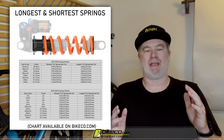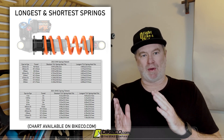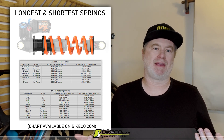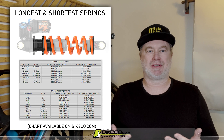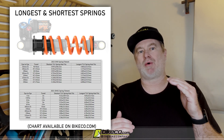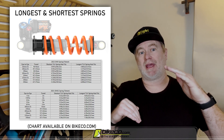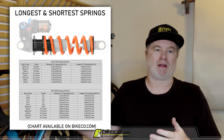When you're looking at coils, you've got some critical measurements you need to take into account. One is ID — it needs to be the proper inner diameter to clear the damper and not come off the spring perches. We work in a Fox-on-Fox world; there's really no issues there if that's what you're doing, but if you're starting to cross through brands, do take a look at that. You've got total length — each damper can hold a specific range based on that preload perch moving up and down on the threaded body. A shorter coil is going to be slightly lighter, though it has to be within an acceptable total length to work with what you've got mounted on your bike.